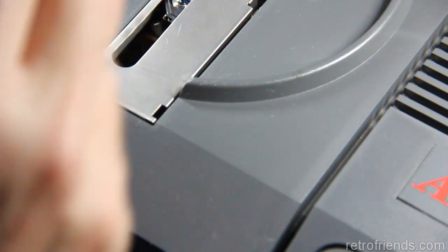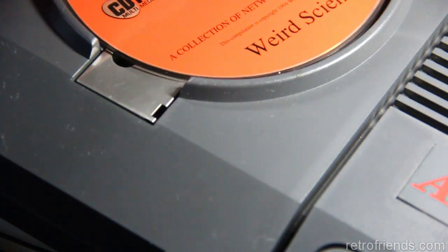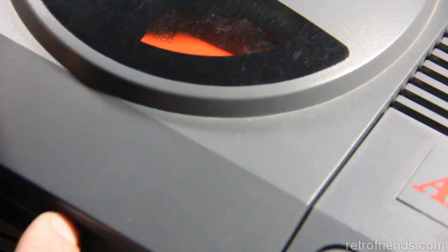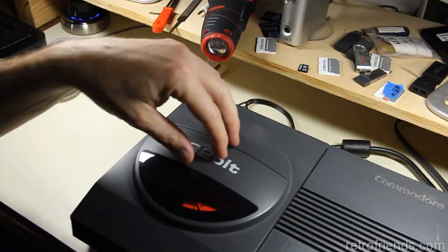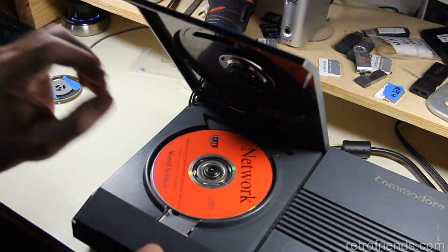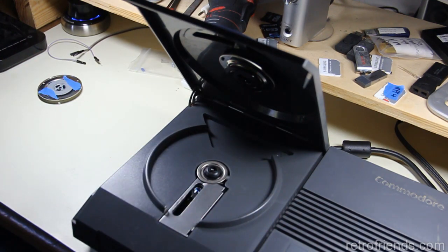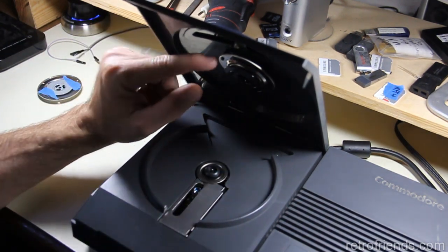I wonder, is this thing spring loaded? It's almost like, you know what? I remember, actually, a lot of people complained about it, but the Angry Video Game Nerd on YouTube actually did a review of this, and he had to put something on top of it to hold it down. Sure enough, it stopped, but I think that's the problem. Yeah, so if you push this down and then you let it up and it stops, so what's happening is it's sliding. It's sliding on the disc and not gripping, which is a mechanical problem.